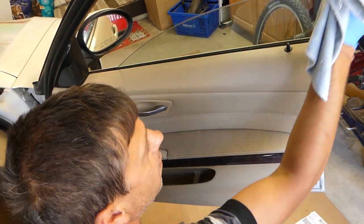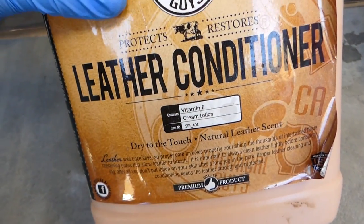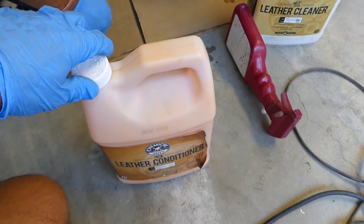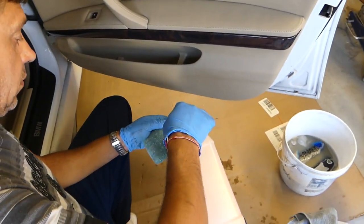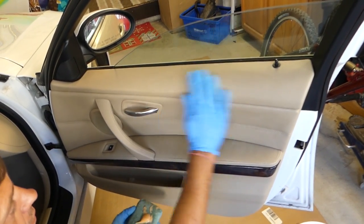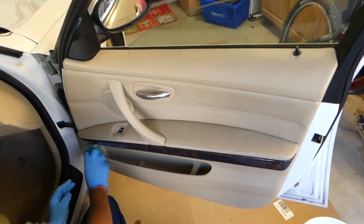The last step for cleaning is to use a dry towel and dry everything. Make sure you don't have any wet spots. After that we'll be using leather conditioner made by Chemical Guys — it has vitamin E cream lotion. Vitamin E gives moisture to the leather, makes it super elastic so it does not crack and dry in the future. It's dry to the touch and a really good lotion. We have links for the small bottles in the description, but we just buy a gallon since we use it quite a bit. We'll put a small amount on an applicator and rub it in with our glove so the leather can absorb it better. You'll definitely feel a difference — the leather will be nice, soft to the touch, and more elastic.